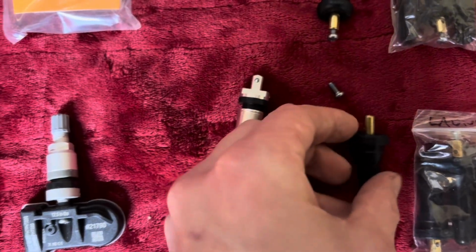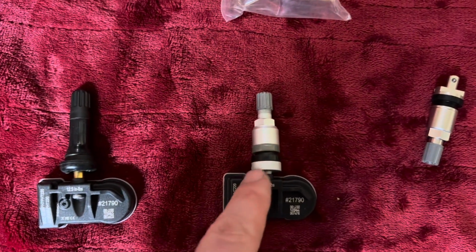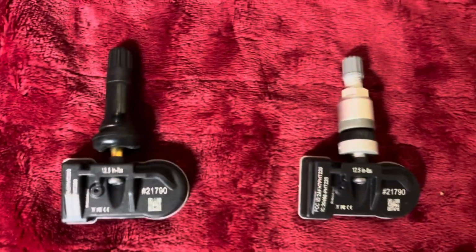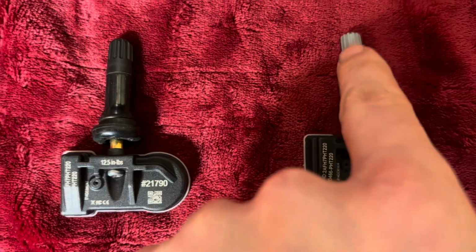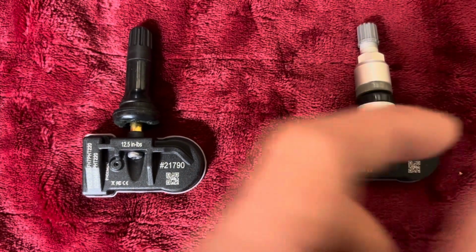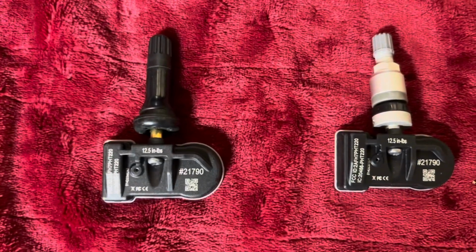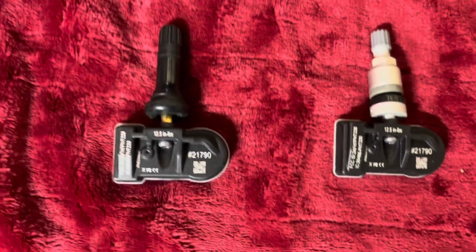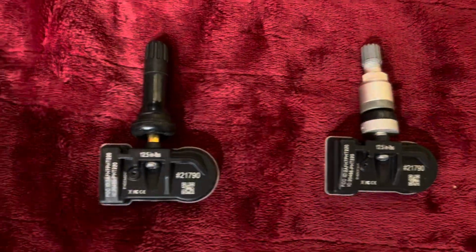So the nice thing about these ones is that the seal is replaceable. It's a fairly common part. They're fairly transferable. It's mostly a standard diameter of the shaft, because that hole size through the wheel is fairly standard as well. So that's one of the key things, is maintainability.